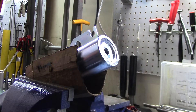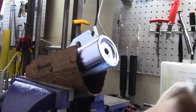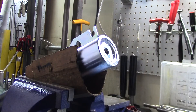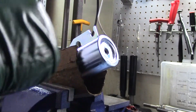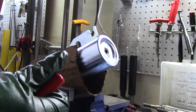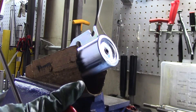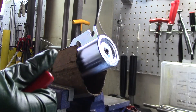The way the bump travel worked out is with the factory setup, the bump stop touched at around 390mm. When I only had the medium segment and one soft segment, it touched at about 350, so I felt like I wanted to add another 20mm just to give a little bit more protection. Ultimately, this is still going to give probably about an inch more bump travel.